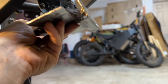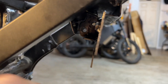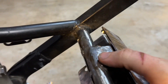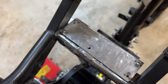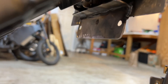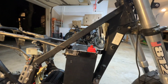Down here is a spot for the fuse. This piece attaches like this — it kind of slides in here and then basically flips over the top. This is another point where the engine was previously attached and I have bolts to go through there. This top portion attaches to this little bracket I created which also has a nut in there so it can be secured from the top. The shunt attaches here, the battery slides into this area, a junction for the ground goes here, and the fuse goes right there. The battery pack slides into the brackets — it's a pretty snug fit but very easy to slide in and it just snaps.